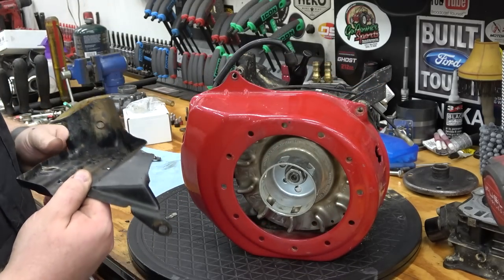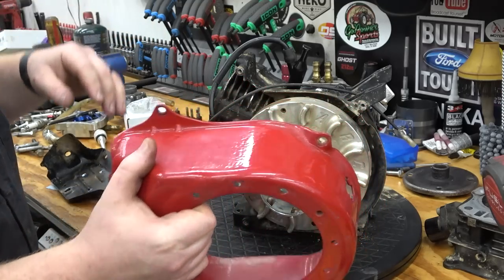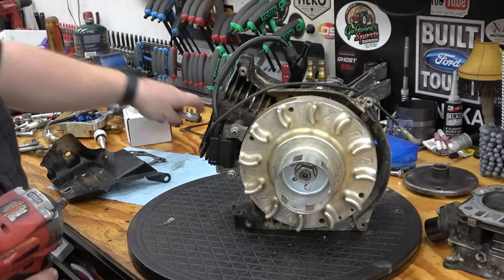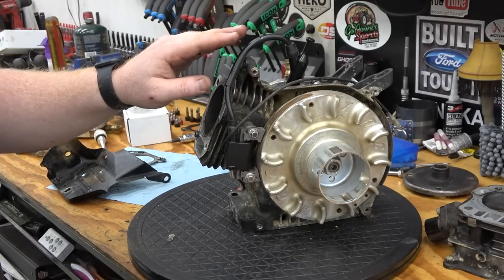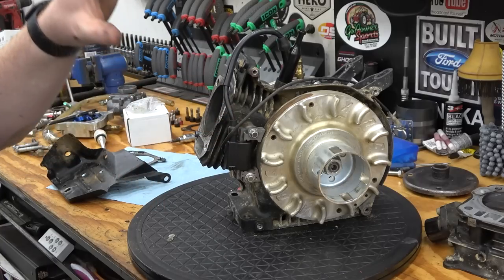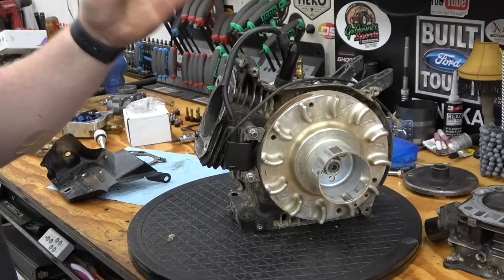One of the greatest things Go Power Sports ever came out with was these thicker side covers — we had ours powder coated red, and they are the cat's meow. They're about three times thicker than your normal side cover, like eighth inch thick — they're crazy thick. And just, if you're ever wondering why we don't run one of our MSD style coil packs on the dyno, that's because they're too dang good — they block all the interference out with the wires we use, so you cannot get an RPM reading. We have to use a stock wire because these let frequencies out. That means our coils are miles above a stock coil, because we're grounding it to the head and using a higher quality wire that doesn't let interference happen, giving you an even better spark.